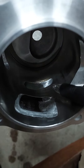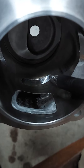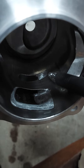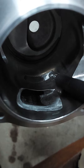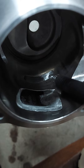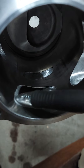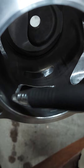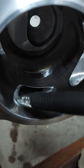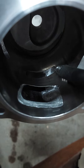Right there you can see I elongated the upper transfer towards the intake, and I tapered it from the intake side back to the exhaust side to where the intake side cracks about 2 degrees early. And then back here in this corner, I took a little bit more out to try and get a little bit more cross flow, where hopefully the mix will come in here and kind of cross these transfers and help push it out this side.